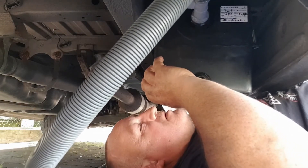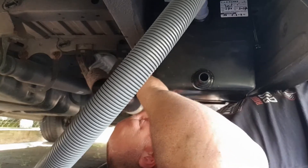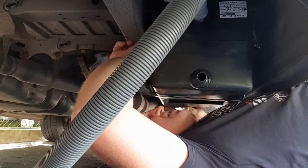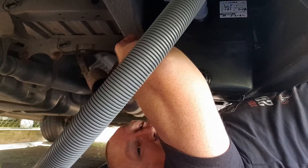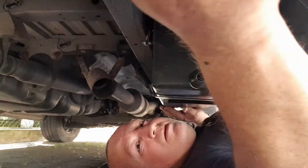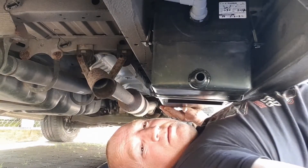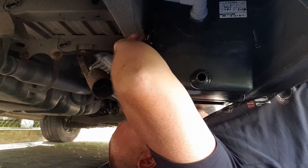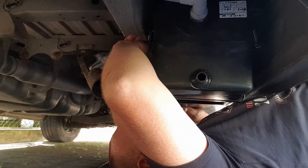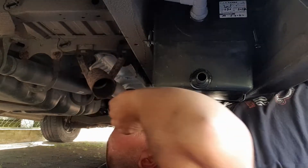It's advised to take your time at this point. Make sure your tank is sitting equally on the brackets and the brackets are square, because if they're not, over time they'll come loose and the tank will start moving and eventually damage itself. It's also well worth it, but I'd recommend every 12 months you get underneath your van and check all your connections haven't moved or aren't deteriorating.